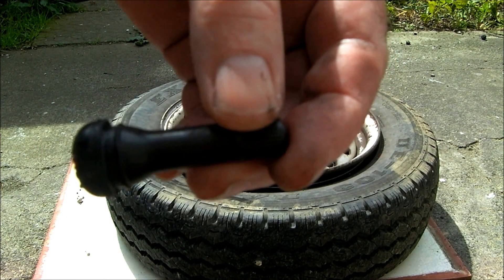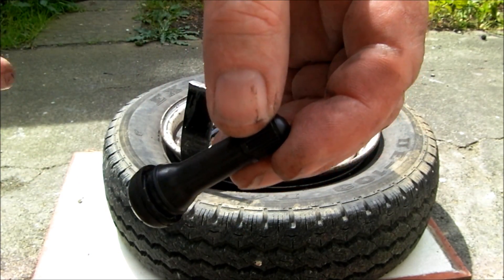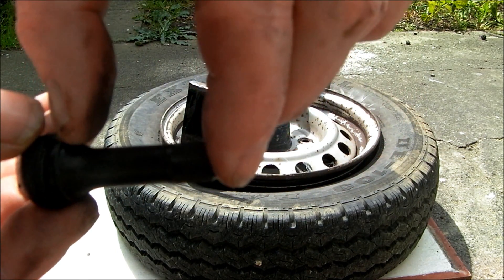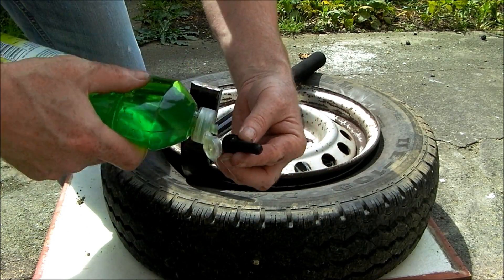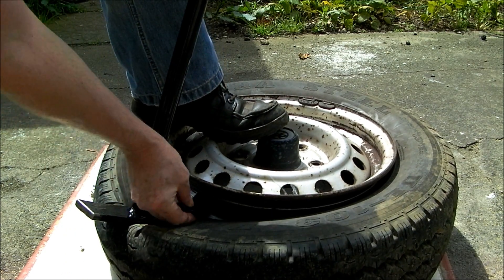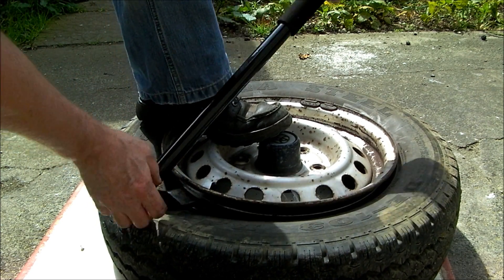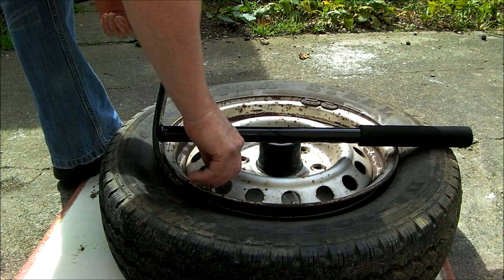Here's the new one. It's a TR414 and I think it's made for an 11mm hole in the rim, and it's an inch and a half that sticks out on the outside. Put a small drop of washing-up liquid on it to help it seat. Put your valve key on it — on the outside of the valve stem — and drive it home.